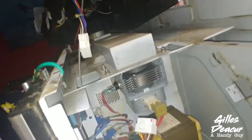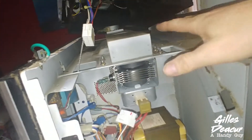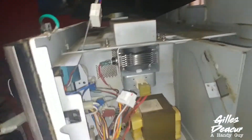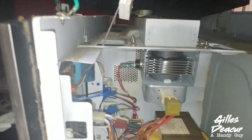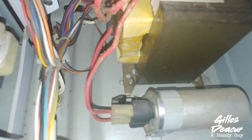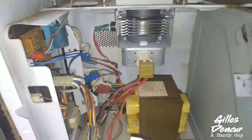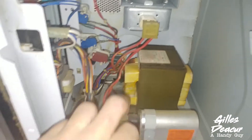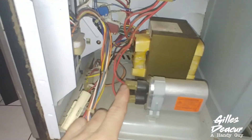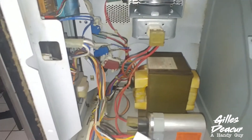With this out of the way, you can access the four mounting bolts that hold your magnetron on. Take a careful look at the wiring, because when you disconnect these — and if you decide to replace the capacitor diode, this is your diode; sometimes the diode will fail and you'll need to replace it — just keep track of where these wires go. It gets confusing when this wire might end up going here and that wire might end up going there.